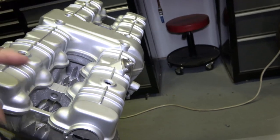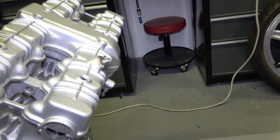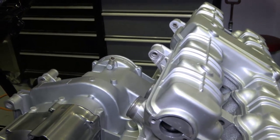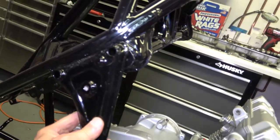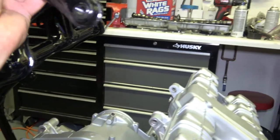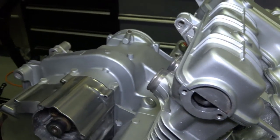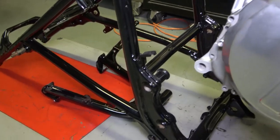One of the motor mounts goes right there at the valve cover, so you really should have the valve cover permanently installed before you install the motor mounts. You attach the motor mounts to the frame, and then — like I explained before — the frame lowers down in place. So you have to have the valve cover installed permanently. A couple of other things also have to be installed before the frame is mounted, one of which is the center stand.